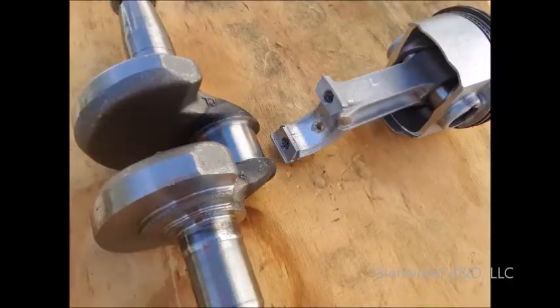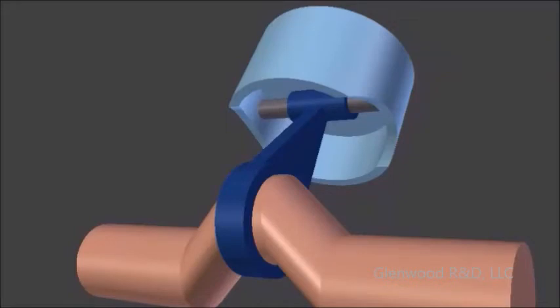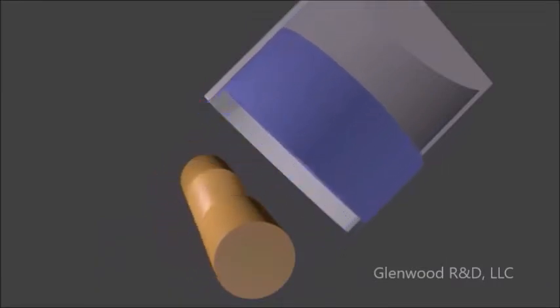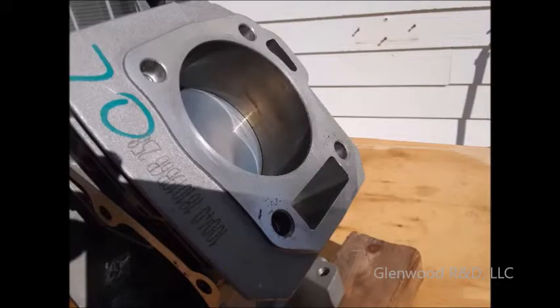We want our drops of oil to be spread evenly to the crankshaft, wrist pin, lower cylinder and piston, rockers and valves, and the tappet and camshaft. The reciprocating motion of the engine will spread a few drops of oil to all the internal points if it is applied in the right place. The upper bore of the cylinder will be lubricated by steam and a small amount of oil carried by the rings.